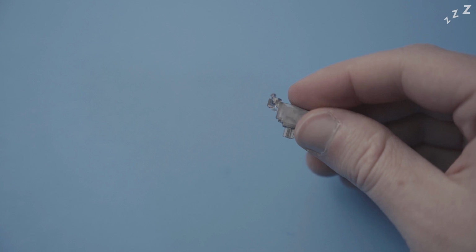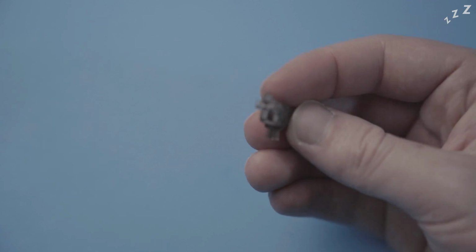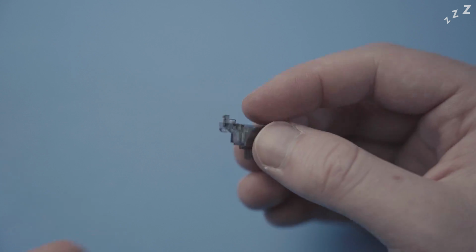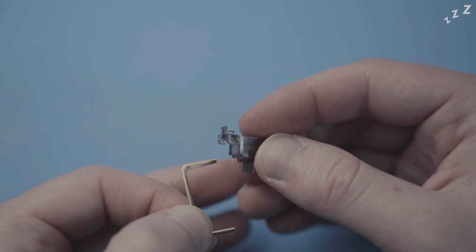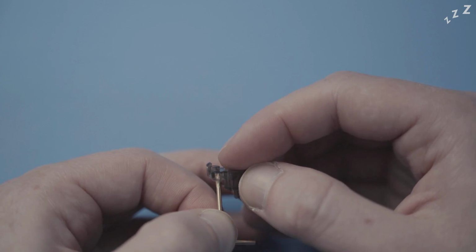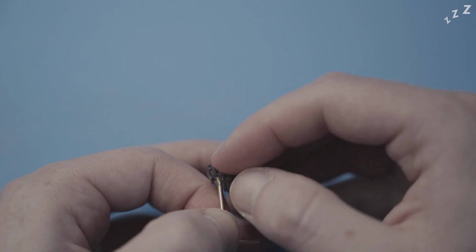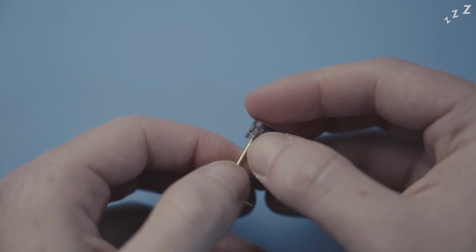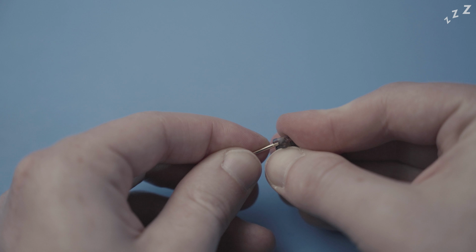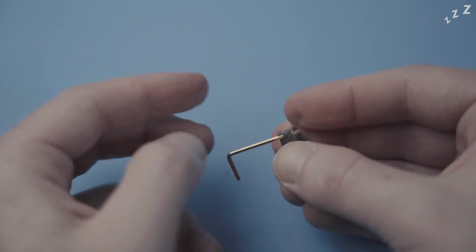Once you're done lubricating one side of the wire, you can go ahead and reattach the stabilizer housing. So the inverse procedure is going to apply here. Start by dropping the stabilizer wire straight down into the housing, and then you can rotate it into place until you hear an audible click from the stabilizer housing and the stabilizer wire.